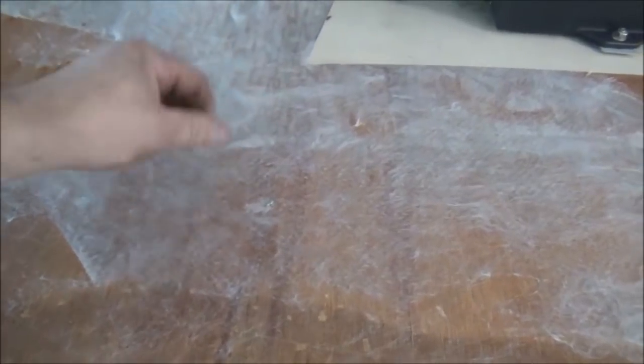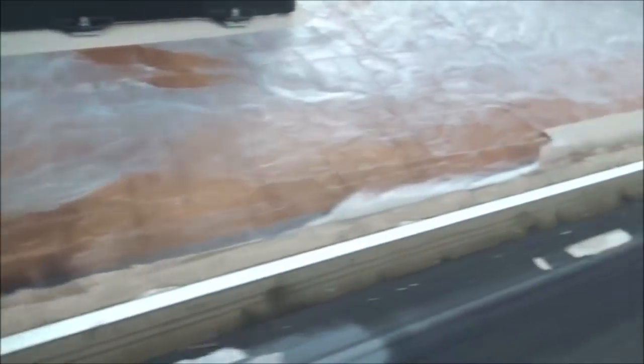You can see we've got some damage here too. This is kind of typical — you would expect more, especially from a high-end coach like this, but it's all the same. This is a fleece-back TPO. So our glue won't stick to it. When you put the glue in, this will all wad up underneath there. So we have to re-deck this.